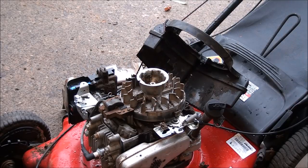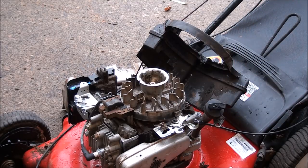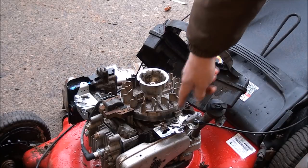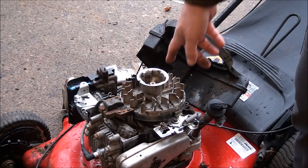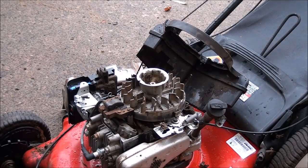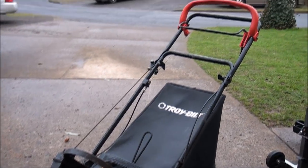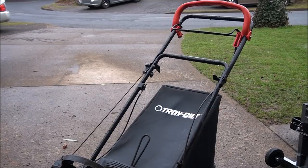That's your coil, and this is your brake — it stops the engine when you pull the lever. See how that moves? There's a little brake pad: when you let off the lever up at the handle, it puts a brake pad on the flywheel and stops it. To get to the flywheel key, we're going to have to take off the flywheel. It's a good idea to lock the handle down so the brake isn't on the flywheel — I'm just using a bungee cord.